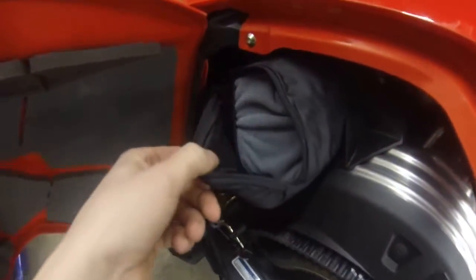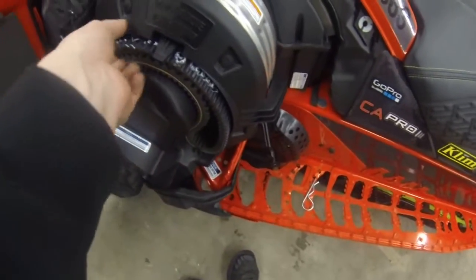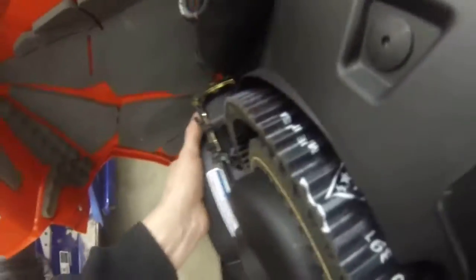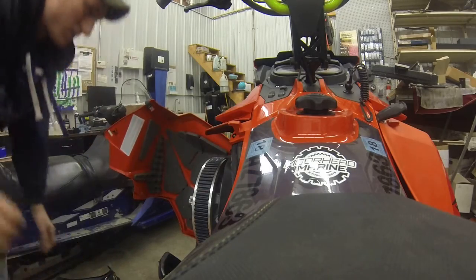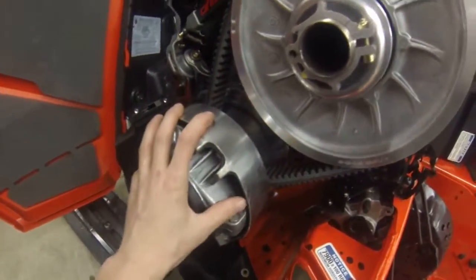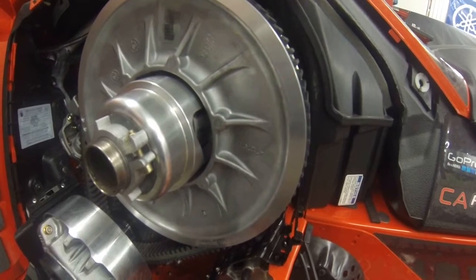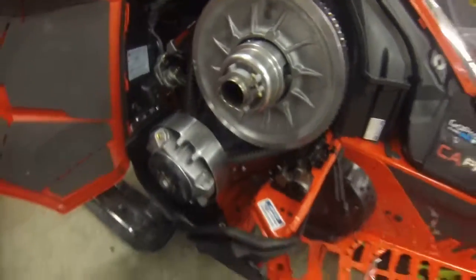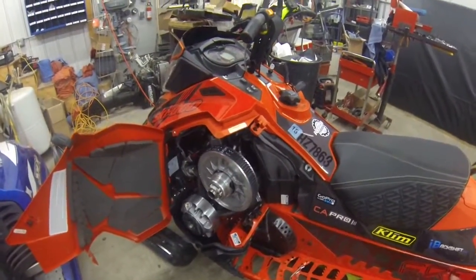Goggle bag — I got an extra pair of goggles in there and an extra belt. I got the QRS Tech Link and the Dynamo Joe clutch kit. I switched my gearing from a 23 top gear to a 20 top gear, so I'm 20/43 gearing now. That got switched out, so I had to go to a 102-link chain.